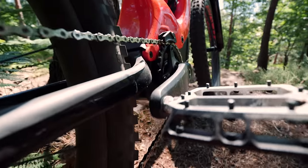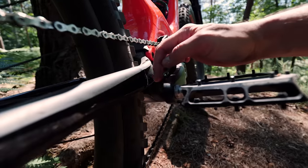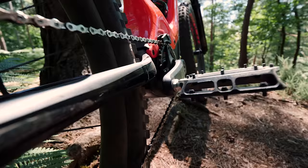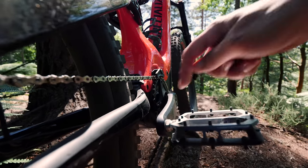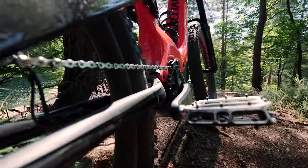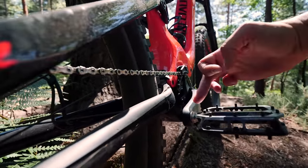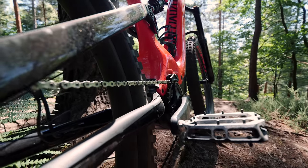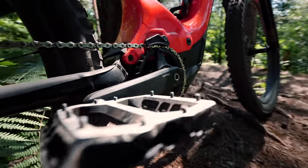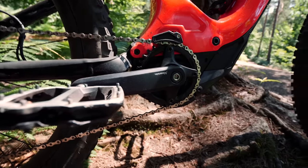When I measured the gap between the chainstay and the end of the crank arm — the inner side of the crank arm — on the stock one, this is five millimeters each side wider. So you're gaining about one centimeter in Q factor. The Q factor is the distance between the crank arms essentially. You are increasing that — that's just one thing to consider. So these are a QF16 Miranda, imported into the UK by a company called Dillglove.